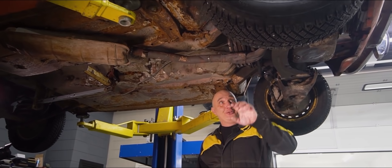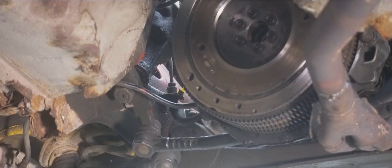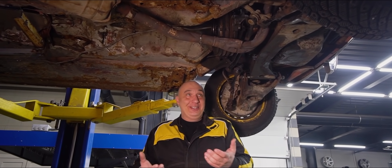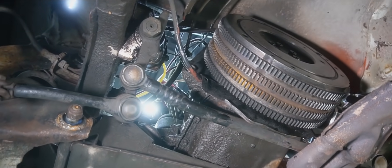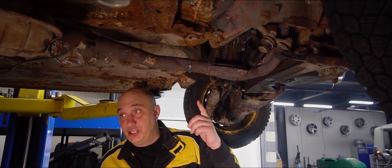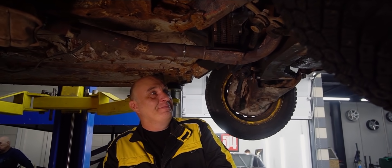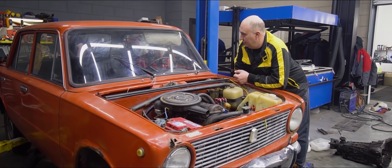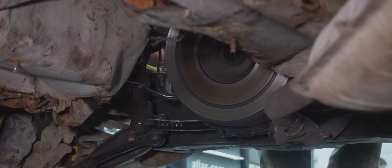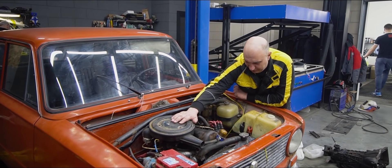Check out this sandwich we made using four flywheels. We're currently at four and it looks pretty dodgy, honestly. More flywheels — that's just so much weight. Seven kilos each, so seven times four is 28 kilograms. Then you've got those six bolts — call it 28 and a half kilos. We've got four flywheels on there, time to do some testing. Can the starter even spin them? That was a joke — well, it started and it's running at idle. Let's see where the revs are at. Nothing seems to have changed — the engine is still vibrating like it always used to.